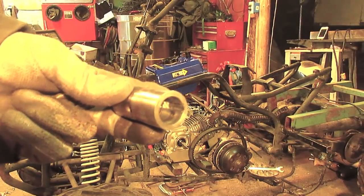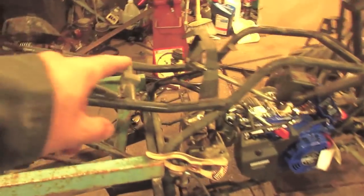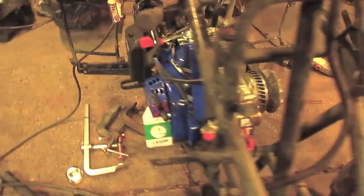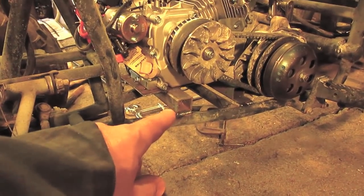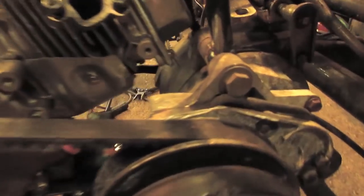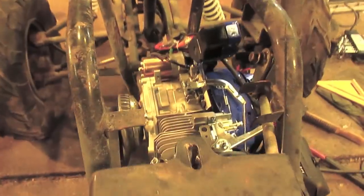I've got a motor mount welded up for the transmission that comes off the frame and mounts at the top of the transmission — mounted in two locations. Got a plate cut for the motor, all bolted in, and motor mounts all welded as well. Used some one-and-a-half inch tubing to bring it up off the frame, with a plate so you can slide the motor back and forth to tension the belt. Everything's fairly tight in here but it still fits really well. Still got to put the muffler on and hook up the tank, put some oil in, and then I can fire it up.